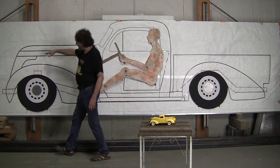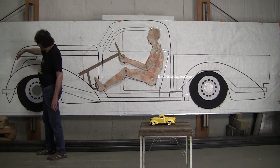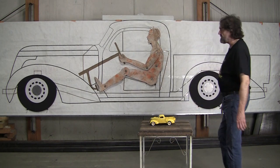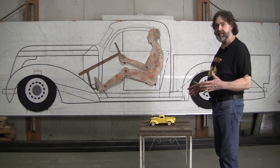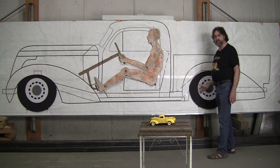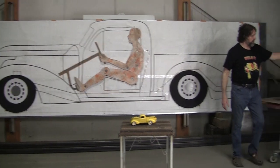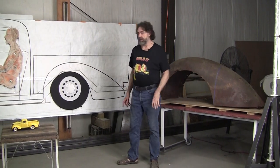It's going to be all aluminum body, aluminum floorboards, aluminum cowl — it'll have some steel in the structure. It's all flat glass; we rake the windshield back just a little bit, probably a couple degrees. This Studebaker grill is an extraordinarily beautiful grill and we've taken advantage of that beauty but also raking it back a little to give it a more racy appearance. It's originally a 115-inch wheelbase and we stretched it to 117 inches so we could center the wheels in the wheel opening.